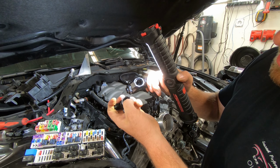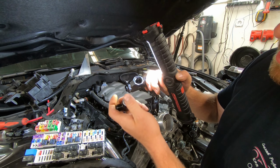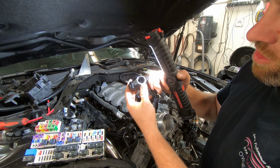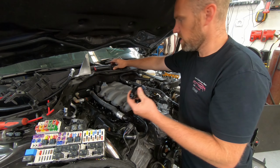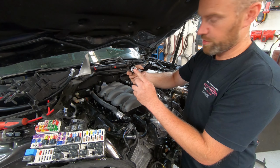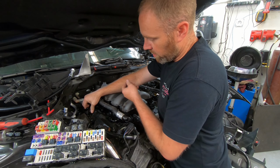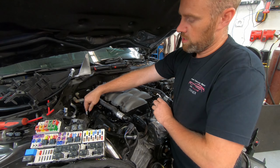So, and then, of course, all these fittings have a chamfered edge in here, so it's got a nice contour flow going in, and that goes into this one and this one. Now, the cool thing about this fitting is by putting it where I'm going to put it, this is where the high-pressure pump is. So the high-pressure pump will be fed full fuel flow from the splitter.